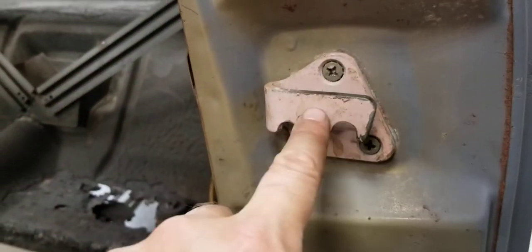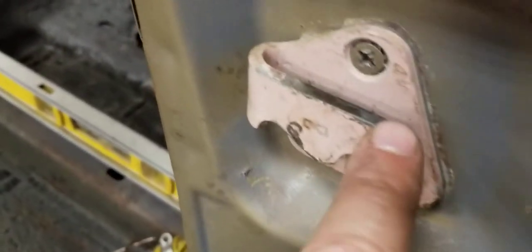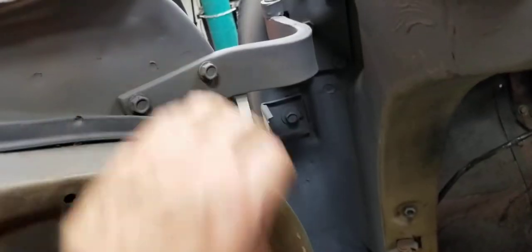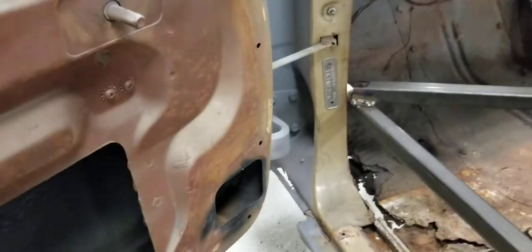It was probably worn right down off. I don't have it in here right now, but this is one off one of the parts cars — one of the four doors. This one seems to work much, much better with the whole top right along here. This was completely worn right down. So this door sagging problem has been going on for a long time and we're not quite sure exactly what it was just yet. We're loosening and doing some adjusting on the door up here and on the lower hinge as well. We've got the door so it shuts decent and the gap is really nice all the way down.